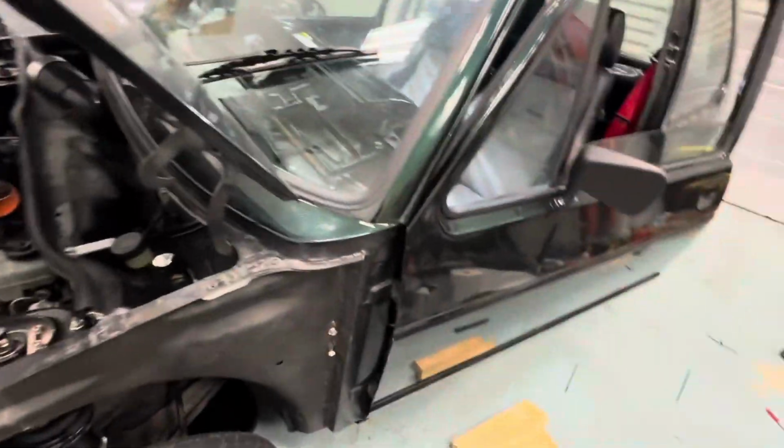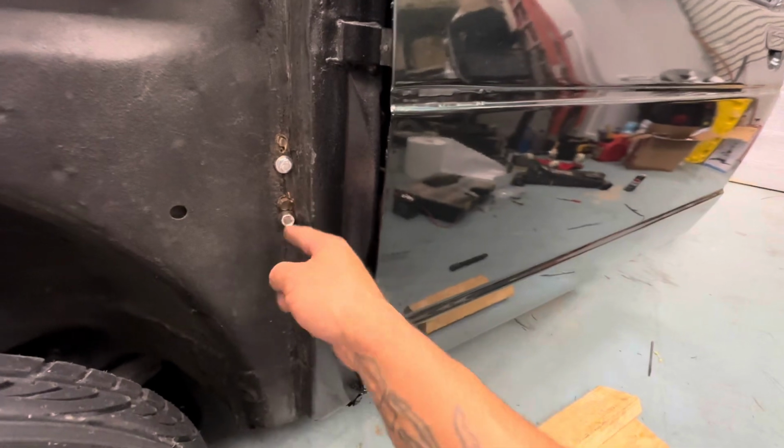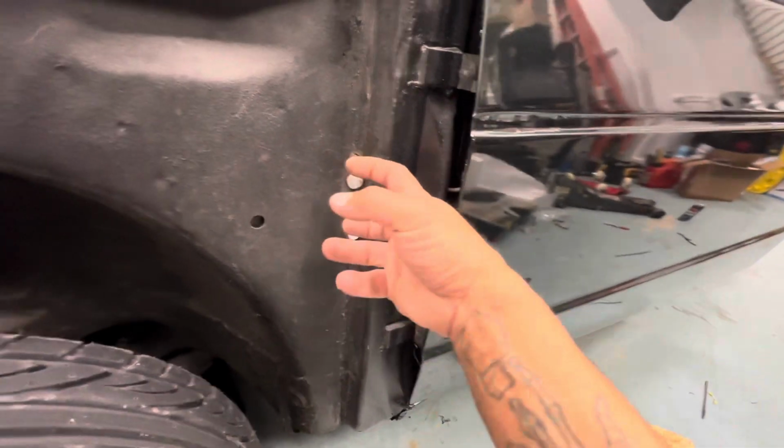It's not easy to line up the holes, but what I did figure out is that when you get your knee bar there and you're right here on the seam line, it's best to take a drill bit and drill through and create your own holes, not try to go through the slides. Create your own holes, then it's gonna be tighter.